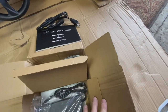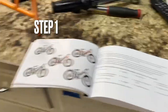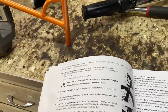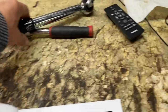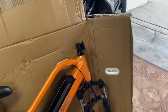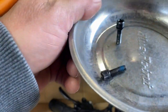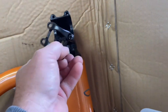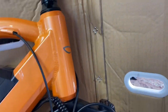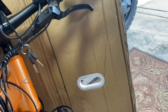There are some extra wires here so I'll read up on all that. Step one is unpack the bike — well, as we can see, I've accomplished that. Moving on to step two: install handlebar onto stem. I've already taken some of the bolts out — they're four millimeter bolts — and Be Cool has conveniently put some Loctite on them already, so they were a little stiff to get out but nothing terrible. Now I'm orienting the handlebars and putting this on.